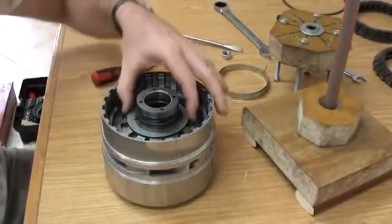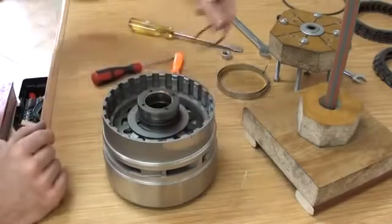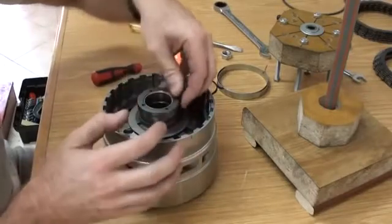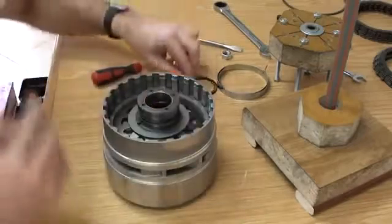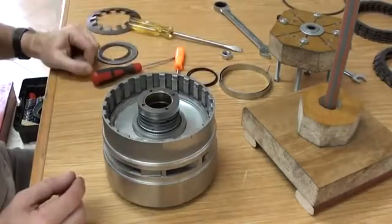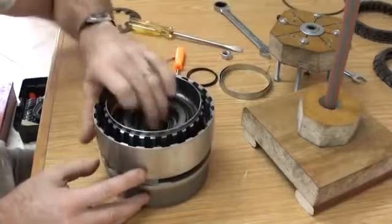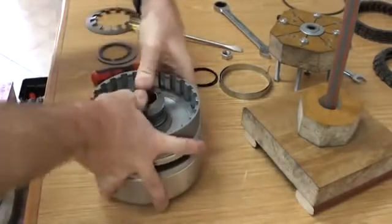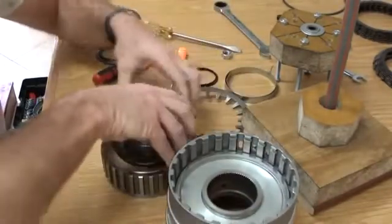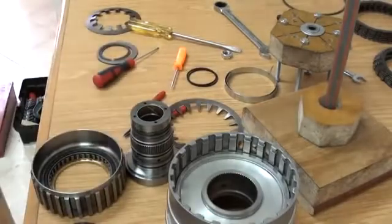Before you actually remove these rings, I suggest removing a couple of small plastic O-rings first so you don't damage those on the way out. If you're rebuilding the transmission you may want to think about replacing those — these actually look in pretty good condition. Now we can just lift that straight up and off. Out comes the cup spring. On the other side we now have our freewheel — we're just going to push that out from the other side, and everything just pops straight out.